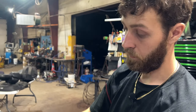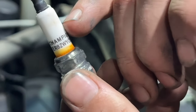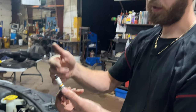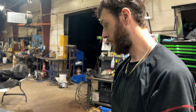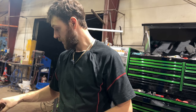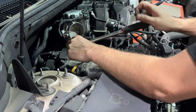Definitely time for a new set of plugs. You can see quite the angle — that should be very square at the end, but you can see how it comes to almost a sharp point. Another thing you can look at is all the rust on there — that's a sign they've been in for a long time. These Champions are the original plugs. Another thing you can check for when you have a misfiring vehicle is a carbon trail from where the plug hasn't been grounding out properly — you'll see a black line on the side of the porcelain. Let's pull this other neighboring plug out and see if it looks the same.